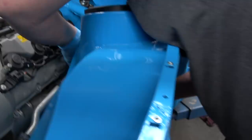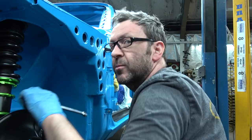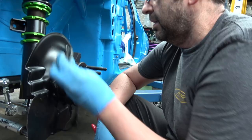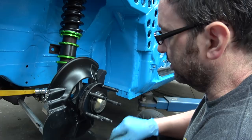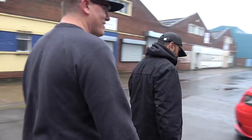Hello Richard - so you're doing brakes? I'm doing the hard line on the brakes. How does the ABS system work for this - do you still need to run a sensor to the disc itself? Yeah, basically these are E36 sensors, E36 hub, and we've got a corresponding rear one. ABS sensors front and rear - it just goes into the back of the hub and picks up off a tooth wheel on the back of the hub, basically counting the revolutions. That goes back to the ECU or the ABS unit. One thing with ABS - they need to have really stiff brake pipes. If you run braided throughout, it causes pulsing problems and you get a weird pedal. It's supposedly very important for ABS to have very stiff brake pipes.